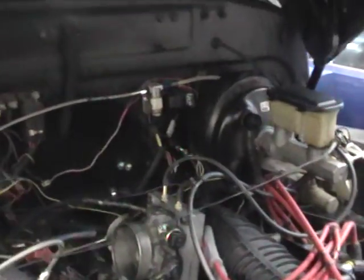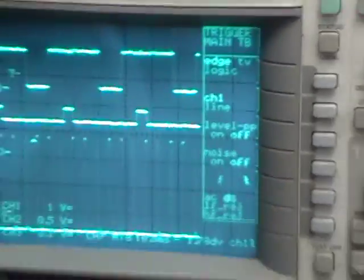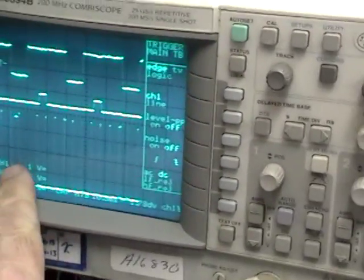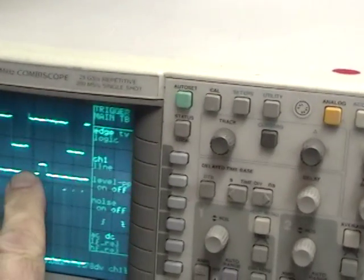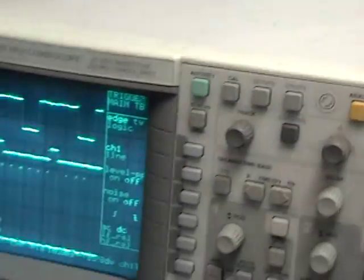You can see the motor's running quite well. You can see the other coils in the back there. Up on the lab scope, you can see the various trigger pulses — the bottom one is from the GM crank trigger sensor, this one is the coil-on-plug signal for number one, and this is the EDIS output plug.